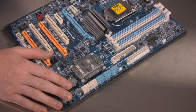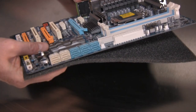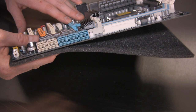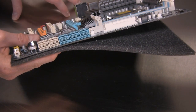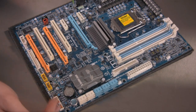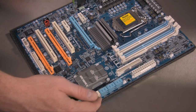Under here we have IO chips like Marvell's 88SE9123 SATA 6 controller. Looking at the SATA configuration, you'll see six blue SATA connectors — those are the six channels supplied by Intel's P55 chipset. These four white ones are currently labeled SATA 3 or SATA 6G, the six gigabit per second specification that's brand new. Where the ASUS motherboard offered a single chip with two SATA 6G outputs, this board actually uses two of those Marvell chips for four ports.